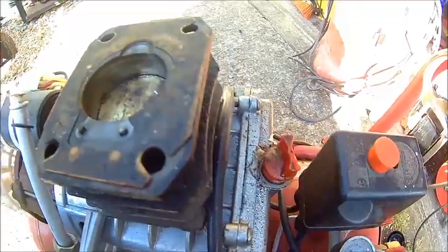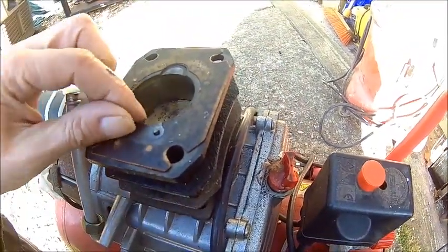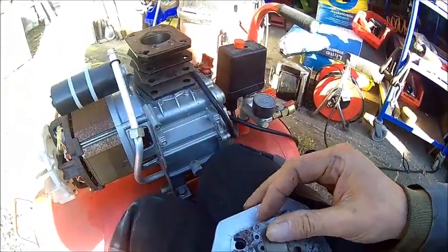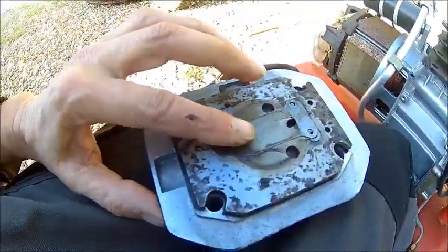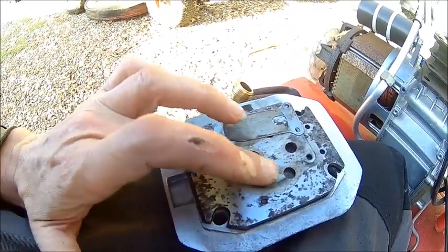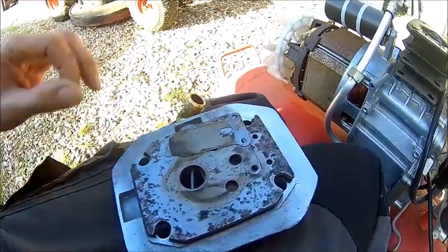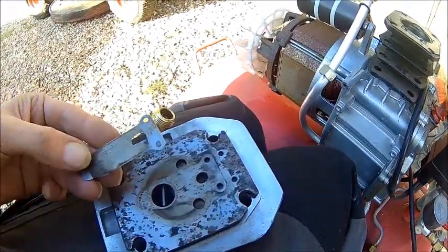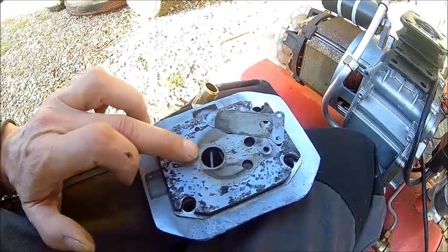Well it looks better than expected actually. The cylinder looks good. There's a bit of debris on top. But the biggest problem is that the reed valve isn't sealing anymore. This is the intake reed valve and it just sits here on that hole. You can see there's quite a bit of dirt. If we clean that, maybe lap it a little bit, it's probably okay because everything else looks fine. Obviously get rid of the debris — give that a nice lap and it should be just fine. This is just corrosion and dirt.